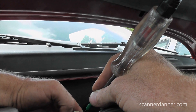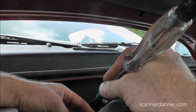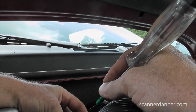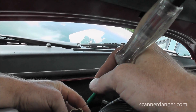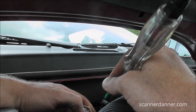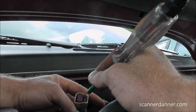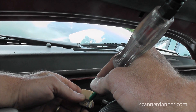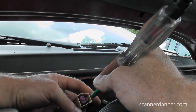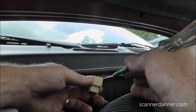Air pump is on. Pin to the left - that's the black wire - I have nothing. Pin to the right, the test light lights - that's the pink and black wire. So let me turn this off so we don't damage the pump - if this diverter is stuck shut, running the pump with the diverter closed puts higher amperage on the motor. The pink and black lit when the air pump was on, so that's the power feed for the solenoid. This means the solenoid is controlled on the power side.